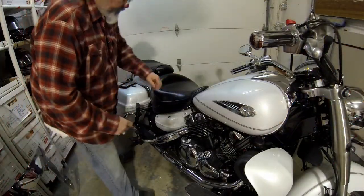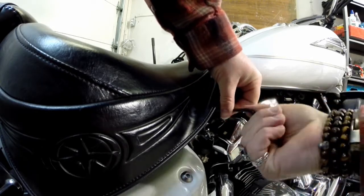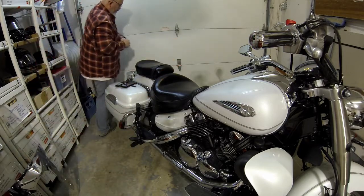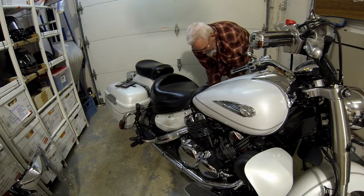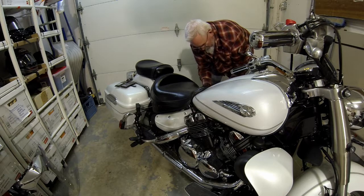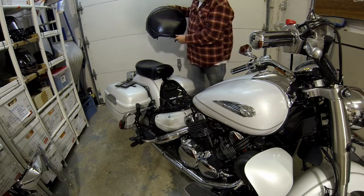First, let's get to our battery. So we will take our seat off. You have your 2 Allen key bolts, one on each side. If you have a cat in the garage, don't leave these around because they're an awesome toy. So once you have your 2 bolts out, lift the front of your seat up and gently pull out.